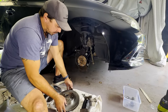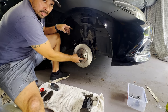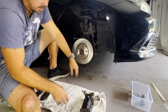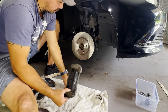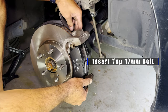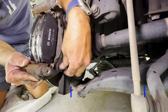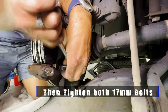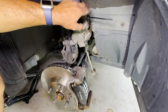Pop the clean rotor on. Some models have a plastic clip that holds it in place but this particular model doesn't, so just carefully place it on there making sure it's not going to fall off. Then get your brake pad bracket and pop it on with the 17mm bolts. Carefully place it over the top, get your 17mm bolt, locate the hole, and tighten it up.